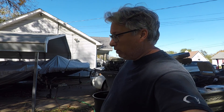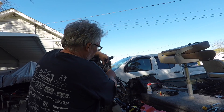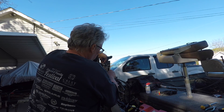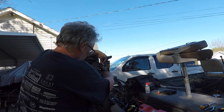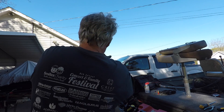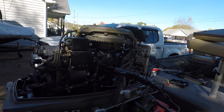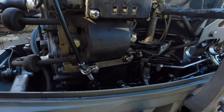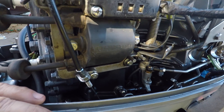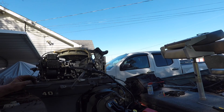So I set the linkage, but now my butterflies are way too cracked open. It's so hard to get a happy medium with this thing. Somehow I got to adjust this down more, and that's by this thing. But then whenever I adjust this jam nut for the carburetors, it seems like I can't get them to wide open throttle.